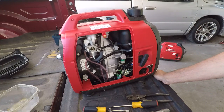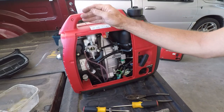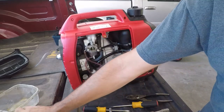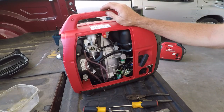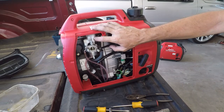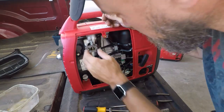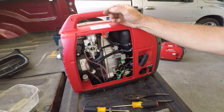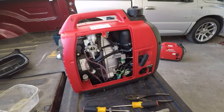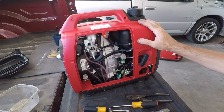So, that's interesting. It's definitely designed to run with the intake in place, because when I went off of eco throttle, and even when this is wide open, it's just breathing too much air and running lean. So, this and all of the filtration stuff that's there is definitely important. The surging is certainly a function of how this is operating. Now, whatever that means, I'm not sure, because that's all connected to the computer control board and everything else. What I'm going to do is put the intake back on, and then start it again and see what it does.